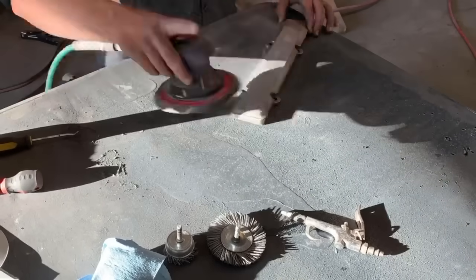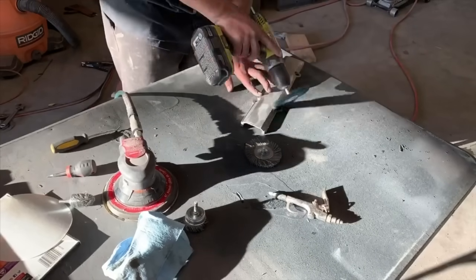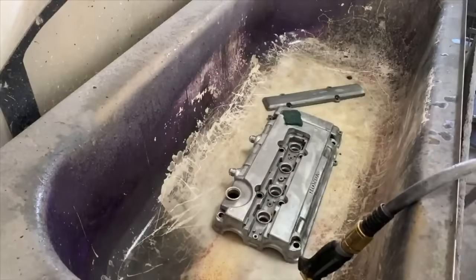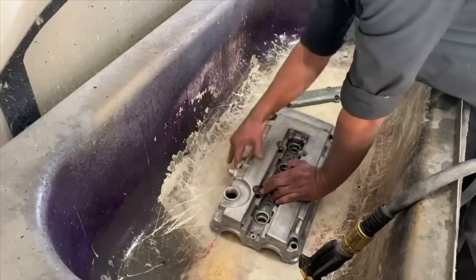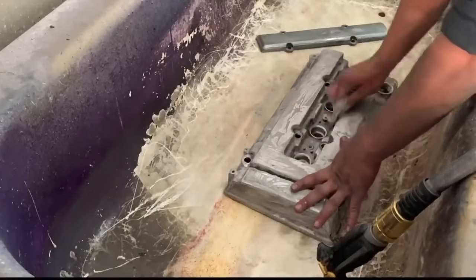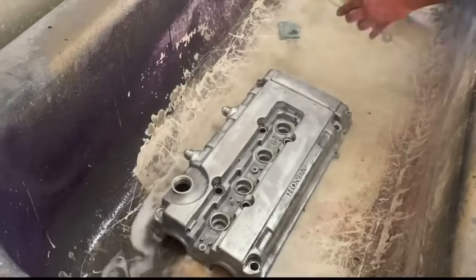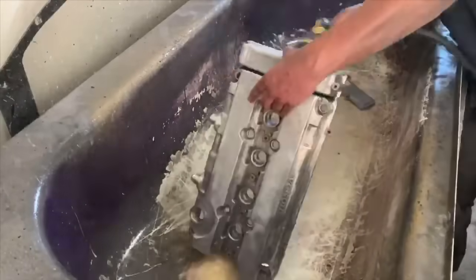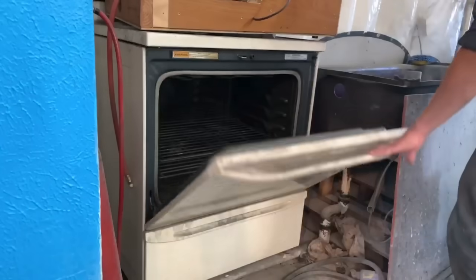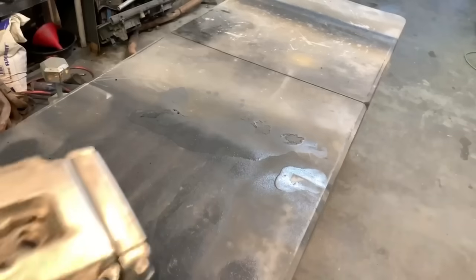For most of the prepping I've been using a 180 grit wire wheel — the gray one — and for this one I'm using a 220 grit. They're both softer than labeled, but you want to use a lighter grit on the plastic. Then I use a scotch bright pad and dish soap, because dish soap degreases, which helps do a once-over and lift anything you may have missed. Then I bake it in the oven at about 300 degrees for about 20 minutes, which lifts any oil that may have soaked into the metal. I don't bake the plastic spark plug cover, obviously.